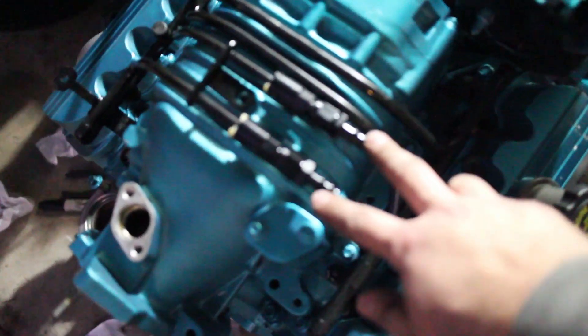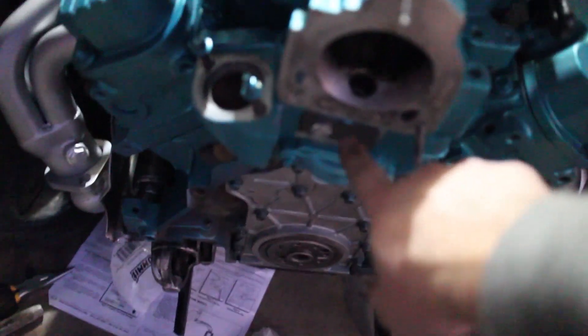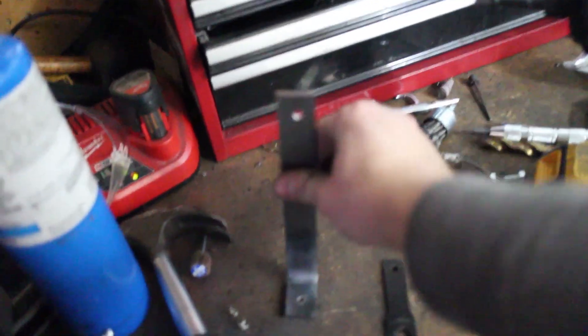It's getting pretty dark out here. We're going to finish up what we're doing. I was able to get these fuel line dash-six adapters — basically three-eighths and five-sixteenths. We have the EGR delete plate on, as well as the front nub. Tristan just fabricated an L-bracket. It's going to self-tap in there and hold the methanol kit reservoir up so we're not using that bungee cord and looking all ghetto. We're going to put that in and finish off the video.